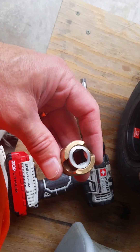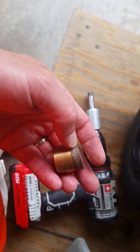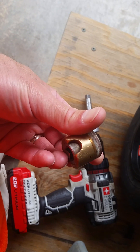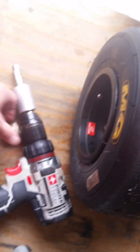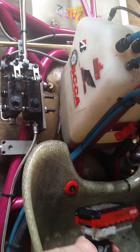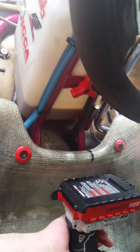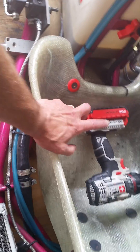This other piece is just a 3/8 inch drive socket. My father, who's a machinist, made the brass piece, and this just screws into the end of the flywheel. You can see it sticking out of the end of the flywheel, and there's a hole in the seat right there. When you want to start the cart, all you do is put that in there and engage it in the flywheel, then pull the trigger.